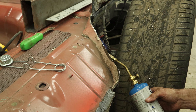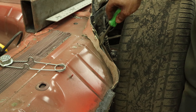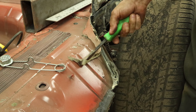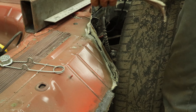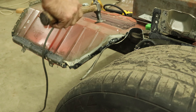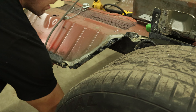So I'm tired of old rusty cars, now we're going to work on new rusty cars. We're back to the '15 — got a couple little scraps of the wheel well to take off, so we'll heat up the seam sealer and pry it out of there. Now we'll grind the spot welds out. We don't care about this piece and we don't want to cut into the panel below, so we'll just knock that panel off. Need a breaker for that last one, and it's done. In the pile.